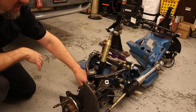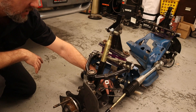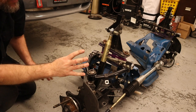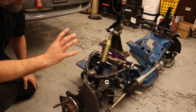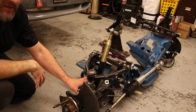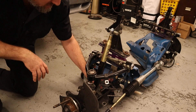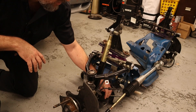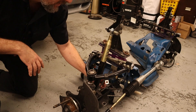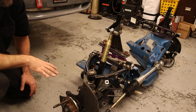Another problem with this suspension design is the sway bar pickup mount — it's kind of off the centerline of the control arm, so it's putting a moment or twisting on this lower control arm every time the sway bar is reacting to body roll. That force goes into this rear link, and rod ends don't like bending loads. One thing I want to do is either change up the lower control arm geometry or change the sway bar mounting to get those forces more in line with the centerline of the control arm.